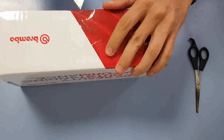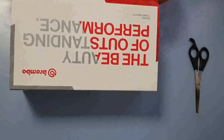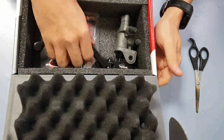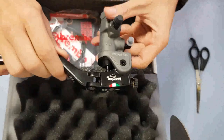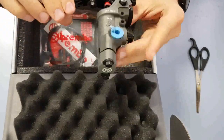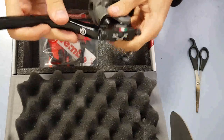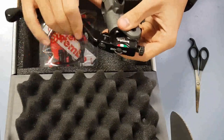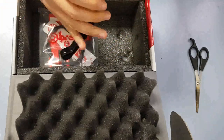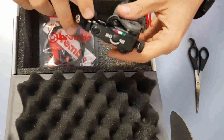The RCS system consists of an adjuster that sets the brake lever pivot distance to either 18 or 20 millimeters for perfect feedback between rider and machine. Setting the pivot distance to 20 millimeters makes the braking system more reactive and immediate, while 18 millimeters makes it more precisely controllable. Changing between the two settings is extremely quick — simply adjust the pivot distance by turning the adjuster on the front of the guide lever.